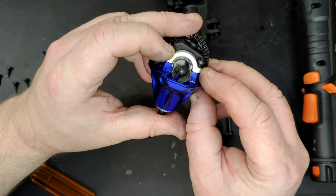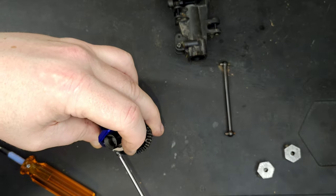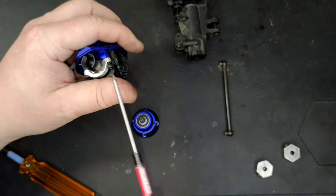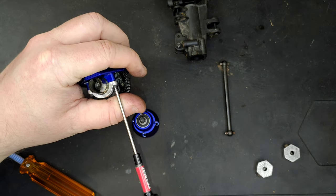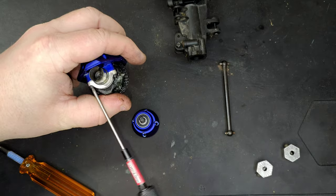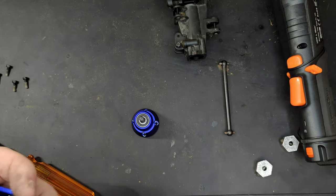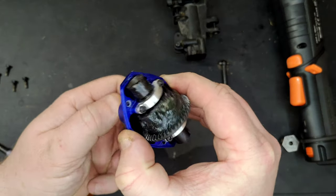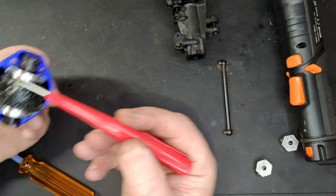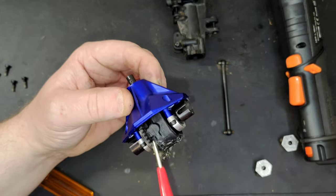And you can tell if you've got it lined up right, because even without it being tightened down, they should be pretty much nipped up. Feels like it's got a hold of that really good. So nothing's grinding or anything. And then let's have a look. So basically we can get some of this grease that's kind of missed this gear completely. So if we gather some of that back up,